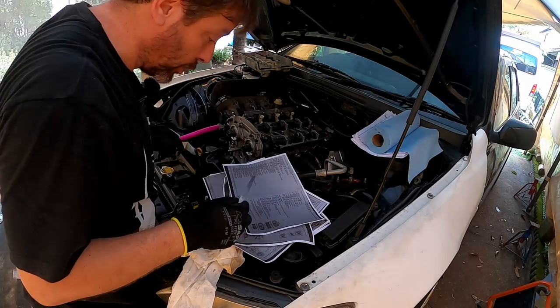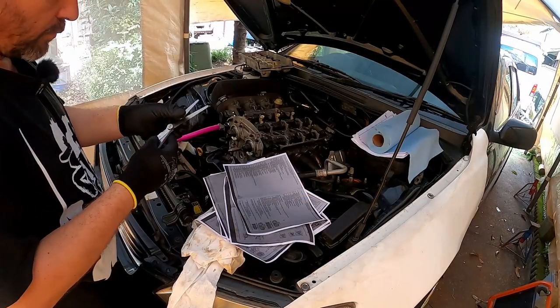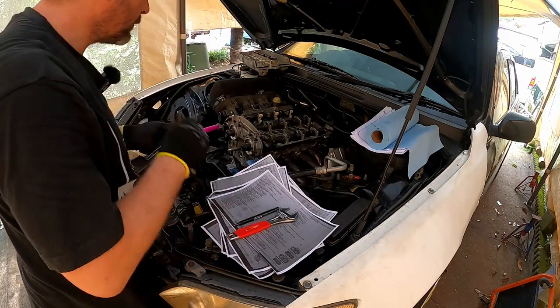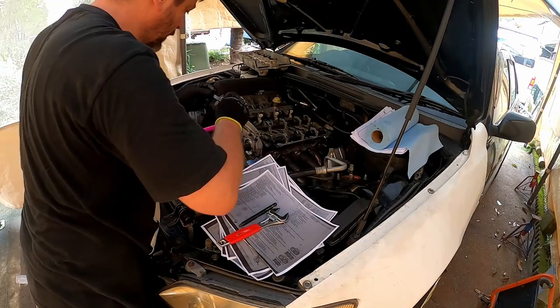Okay, so it's less than 0.2. We know that much. 0.19. Try and get that in there. 0.19 won't fit. 0.18, yeah. Okay, so it's 0.18. That's within spec. Write it down, because if you don't, you're going to forget. 0.18, does it fit? Yep, 0.18 fits.